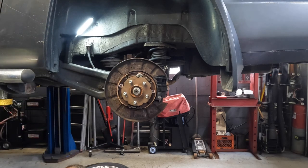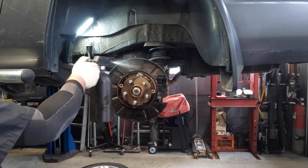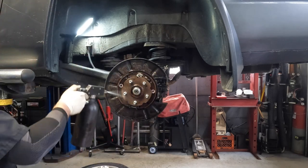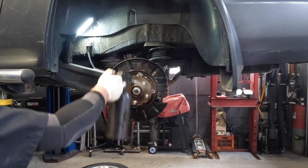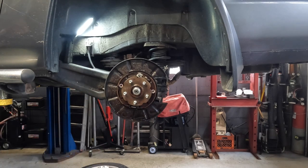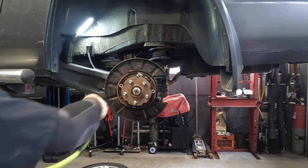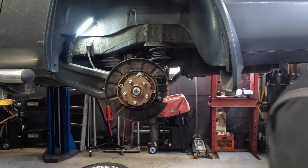What we're going to do is take our drain pan and put it underneath. We're just going to spray this down with our brake cleaner - just take off any dust so there's no dust inside of our drum hat rotor setup once we install the new one. I go pretty generous on here, just get all that crud off, and at this point you can let it dissipate - it takes a little bit - or just take your shop air and blow it off. Now it's nice and clean. Brake cleaner evaporates very quickly.